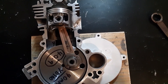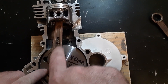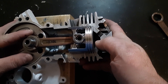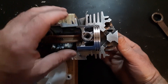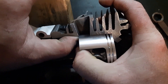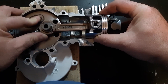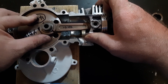Here is the 40 millimeter stroke crank out of a YD100 — 40 millimeters, 40.9, same rod, same bearing, same piston. At the top of this, the piston is about 0.6 to 0.7 millimeters from the top. A lot of people think this is correct and it's not. Number one: if you notice, your skirt is just about going past the exhaust. Up above here, it actually catches on that exhaust port because it's just going above it.